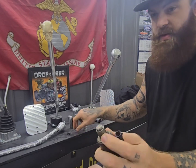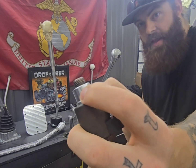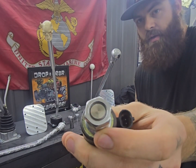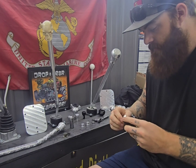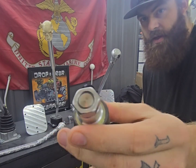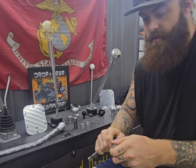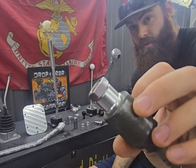You can see there are barely three threads, so what I did is I made this sleeve that allows all your threads to show so you can have full thread engagement with the nut. Not only that, I have a secondary locking mechanism — first you tighten it with your ratchet for full thread engagement, and there's also a set screw that provides a secondary lock. After you tighten the jam nut, this thing is not going anywhere at all. No more issues.